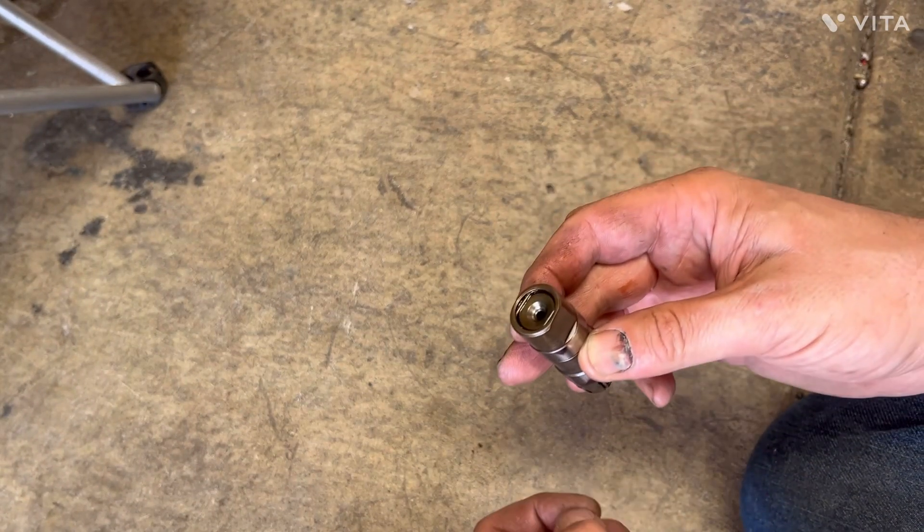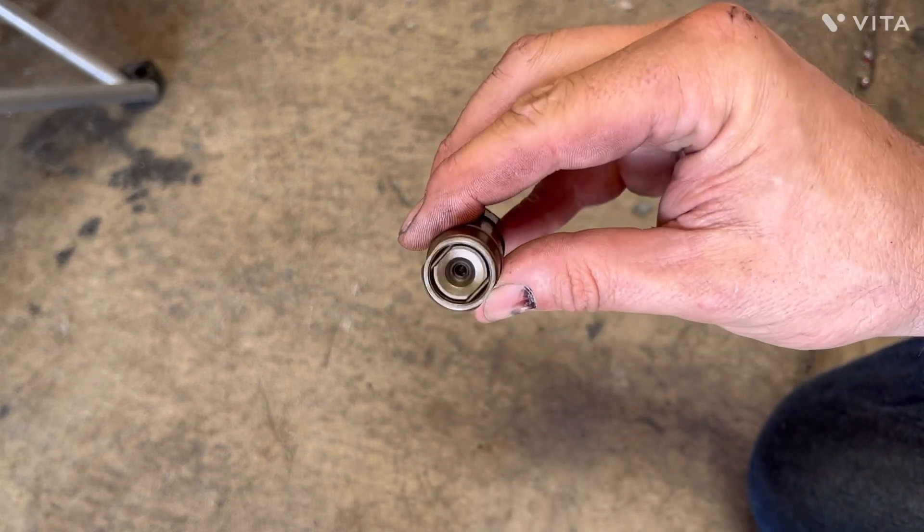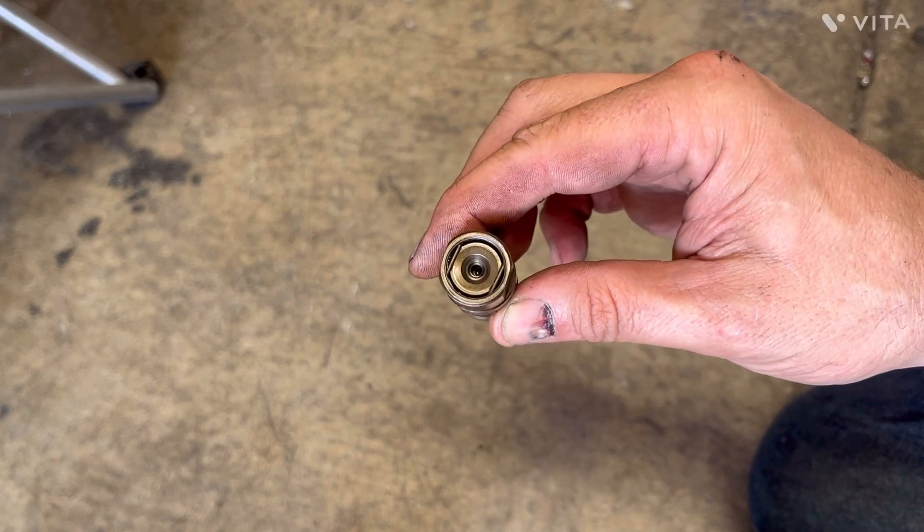You can either use a checker spring — a real light checker spring to replace your valve springs on the head — or do what I'm doing: you can turn a hydraulic lifter of any kind into a solid lifter, just for piston-to-valve clearance checking purposes.